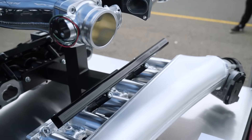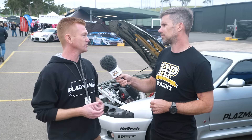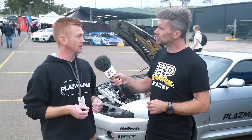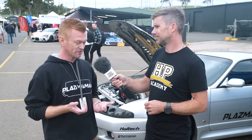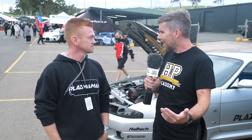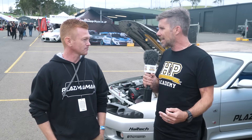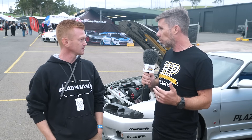Things like the big block manifold are constrained by the cylinder heads, so you can only improve them so far, but we certainly do wherever possible. The factory FG manifold is one that everyone says can make 1,200 to 1,400 horsepower — you can — but ask any tuner how much they're trimming cylinders 5 and 6 and they will say it is very, very bad. If you ever get a chance to hardness test the pistons afterwards, you'll find number 6 has been very, very hot. Without the data, it's easy to assume everything is fine, and as power levels and boost climb, those small inconsistencies that were acceptable at factory power levels start to become more of an issue.